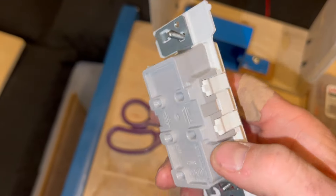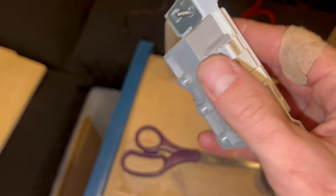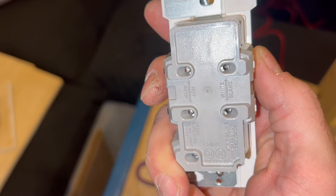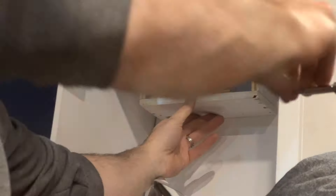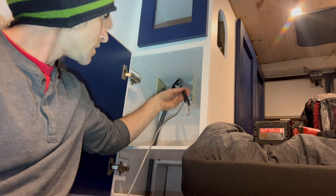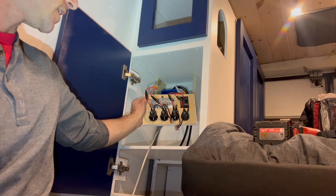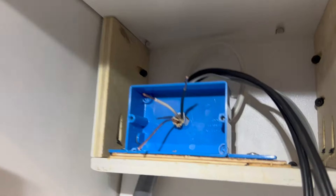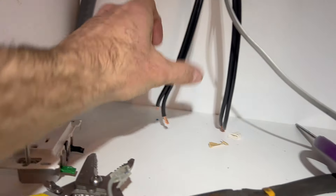Now I just got to connect it all. This is a pretty cool outlet - it's just like those Wago connectors: you flip open a switch, put a wire in, and that's it. The control center has all the clip-ins ready to go. I was able to get the conduit in, strip back the wires. I'll leave them long so I can lean in and connect everything pretty easily. Almost there - got those ones through the box, these ones ready for their Wagos.